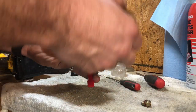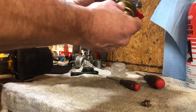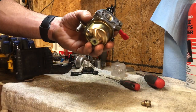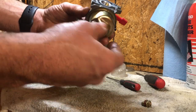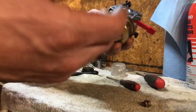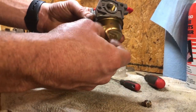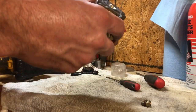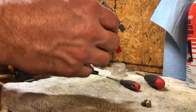Double check everything — jets in. We want to line up our fuel drain. Angle that to where you can drain this carb down when it's out of season — take that out and drain your carbs, especially if you do run ethanol. You'll thank yourself later. Keep that ethanol out — what I do sometimes is just pinch the line if I don't have a valve. Sometimes I'll put valves on them for people with this ethanol issue.